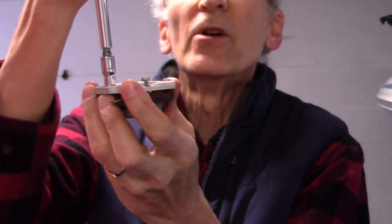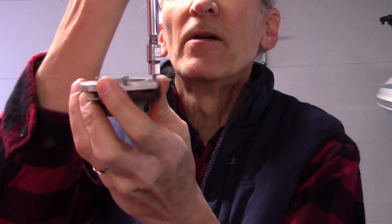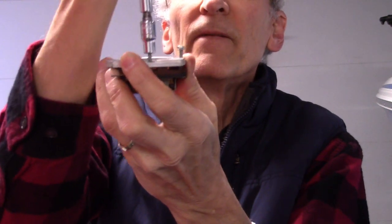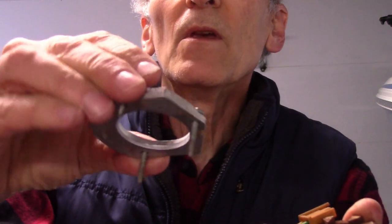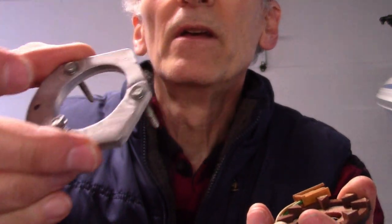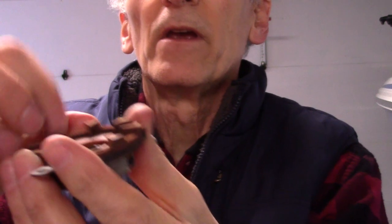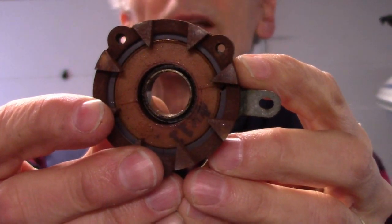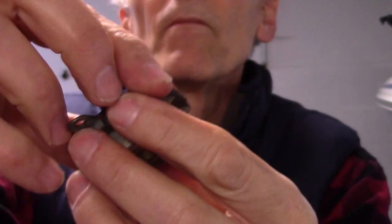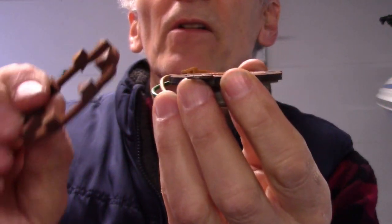In order to take this out of the distributor, you need to disassemble it. You can see it in the shop manual — they'll run these screws out here. Once you do those three screws, you lift that top piece off. I think the book calls that a magnetic shield. And here's that piece with the magnetic points on it — that comes apart off the top.